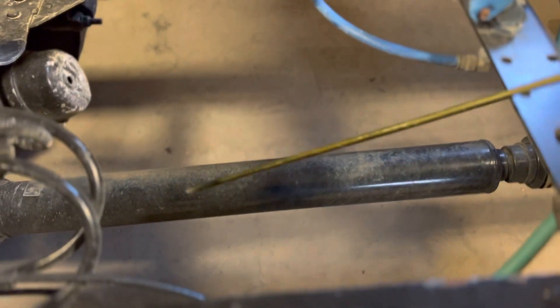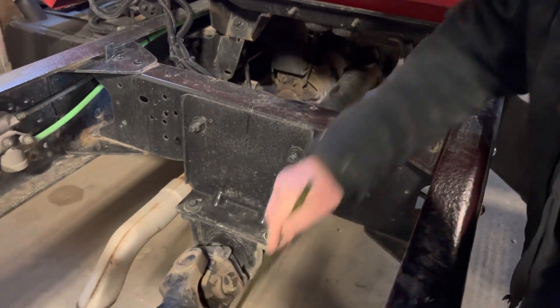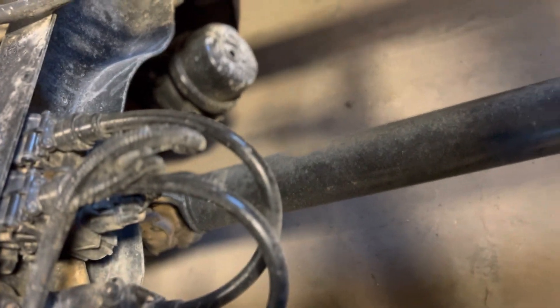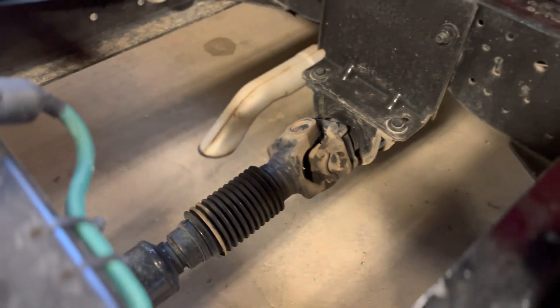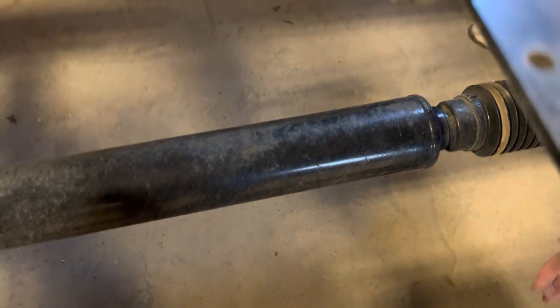Under the vehicle — the drive shaft. My drive shaft is right here. It's straight from here all the way up front — not cracked, bent, dented, or sagging. It's properly greased at its knuckles or joints right here, up there, and back here. There are no missing nuts or bolts or shiny exposed threads. These hoses here are not hanging below the frame to get stuck in the drive shaft. The drive shaft is securely mounted.